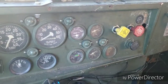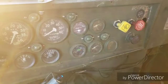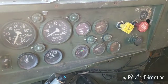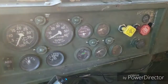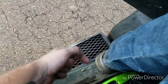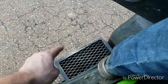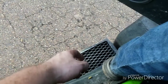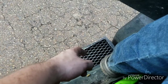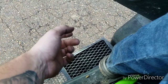A common problem on these trucks is going to be the Q2 valve, which is up on the front of the truck. There's a little drop-down piece right in front of the front axle with five lines going to it. The Q2 valve has a vent line that runs from it down the driver's frame rail. There are three vents: one from the front, one from the back — both axles vent to one line back to the vent on the frame rail — and a vent from the inversion line, which is for when you use your front glad hand for service on a tow bar.